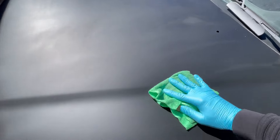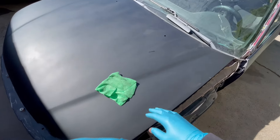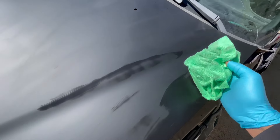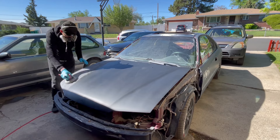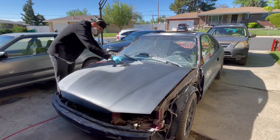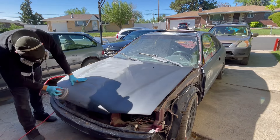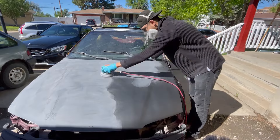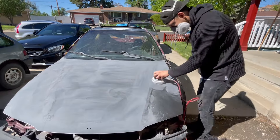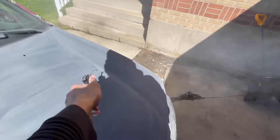You can see there are some spots where the paint gun laid the epoxy on kind of dry — you can hear it and the microfiber wants to get stuck on there. Even though the surface is kind of rough, it doesn't really matter too much with epoxy primer because it gets sanded anyway. Here I'm going back over it with the 220 just to spray epoxy over it again to make sure we have good coverage and the rust and corrosion protection we need.